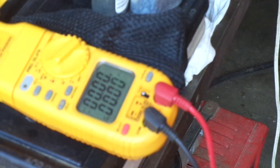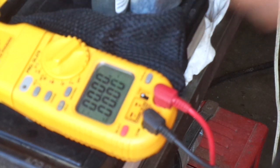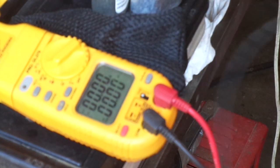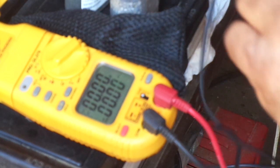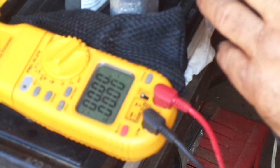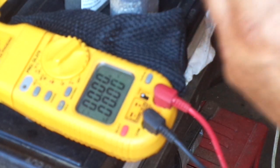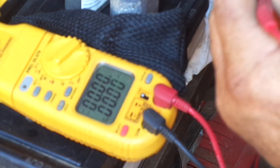The scale we're going to be concerned about is the bottom scale, because that's the scale that's going to read the microfarad. You've got to set your selector — if you're fortunate enough to have a meter that has a microfarad selection — rotate it to the MFD or capacitance scale. Now this is the one that came out of there; that's what I consider to be the faulty one. What we'll do is short out across the two terminals — no big deal. There's nothing but the battery voltage within your meter that actually charges it if it's capable of holding a charge, so it's not like you're going to hurt yourself.